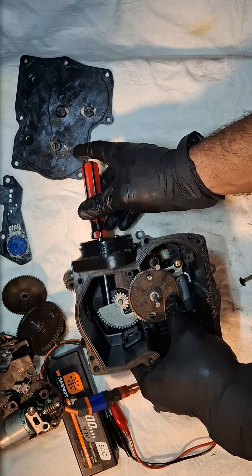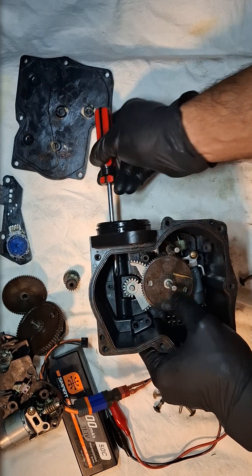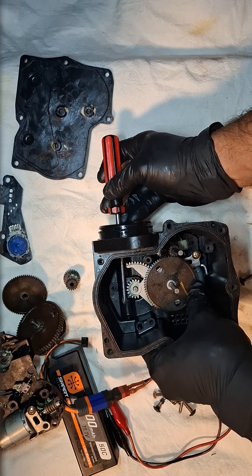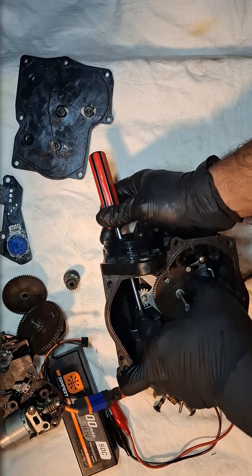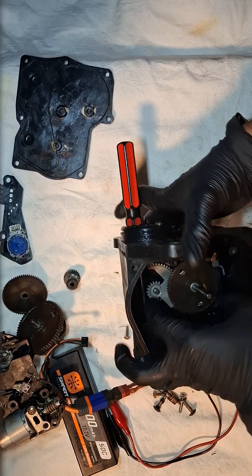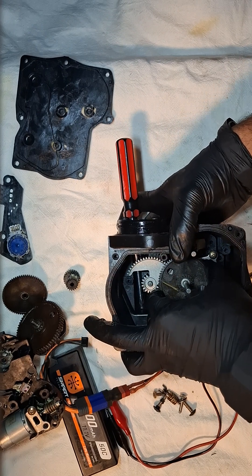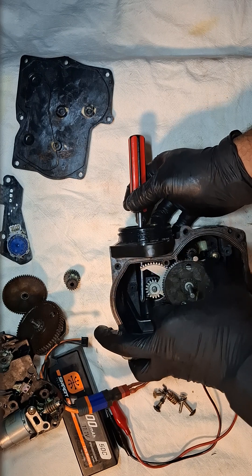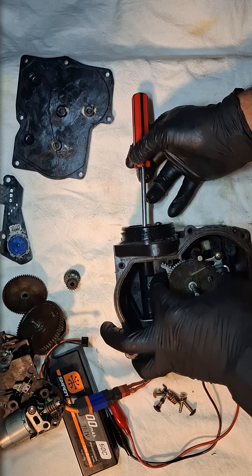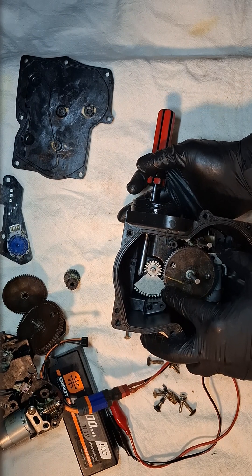What should happen is: your shaft comes this way, and then your gearing here engages for four-wheel drive. This gearing comes all the way up to engage, and once you release four-wheel drive it goes back to where it was. But what happened is it goes all the way down, gets lost, and keeps spinning without engaging anymore.